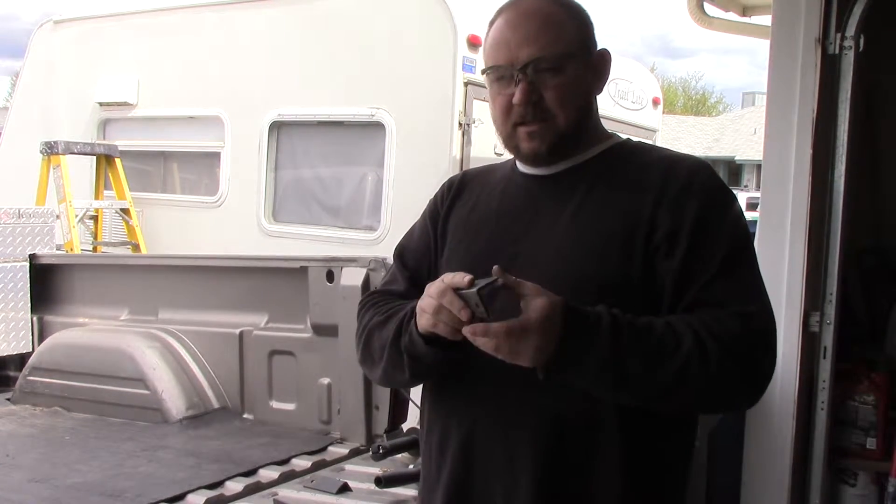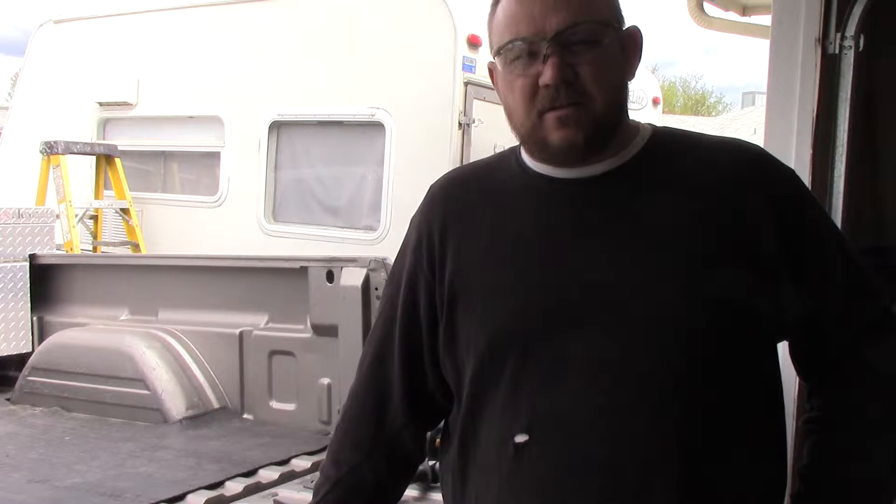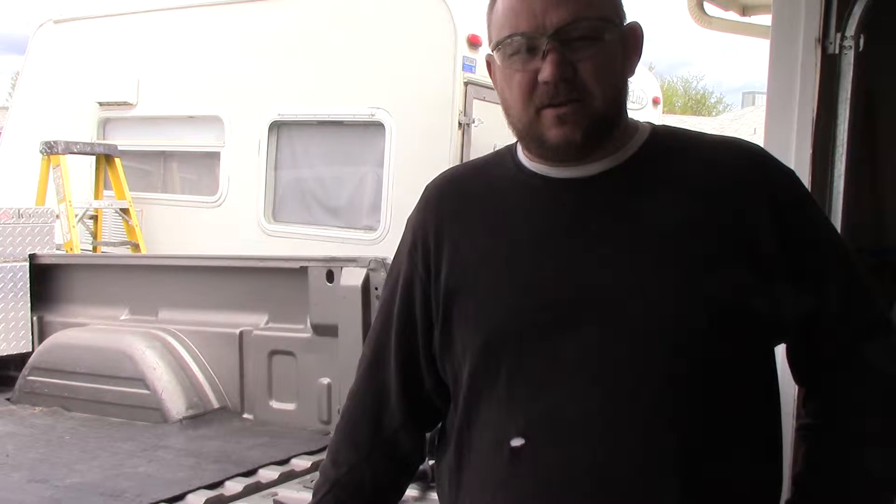These are going to have two four-inch lag bolts that are going to go all the way down through the decking on the top, down into the camper. The reason I'm doing that is because the roof of this travel trailer — there's only like an eighth-inch, maybe quarter-inch plywood on top. Underneath that is an inch and a half of foam insulation, and then that's pretty much it. It's really thin, and there's a couple other layers of vinyl on top and underneath. So this is going to be lag bolted all the way down through that. The vent fans screwed in up there don't weigh much, but these solar panels do — they're 50 pounds each, so they've got to have some significant mounts to hold those up there. I don't want to lose one going down the highway. Lag bolted all the way through, big inch-and-a-half washers on each lag on each side.